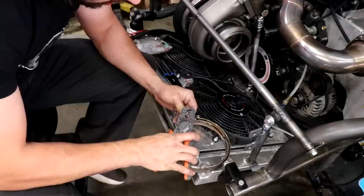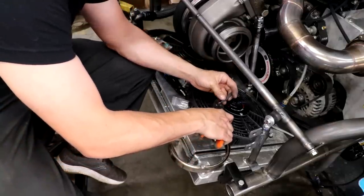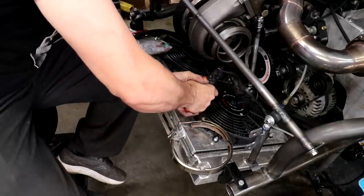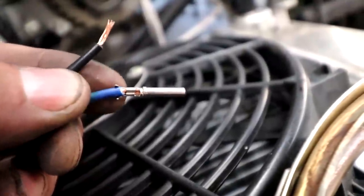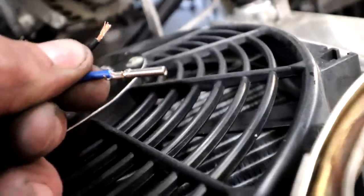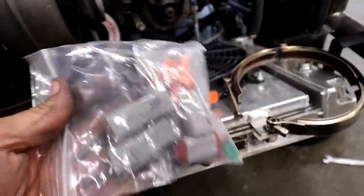I'd show you, but I'll probably mess one or two up. I like to get mine seated in the pliers first, and then shove the wire in there. Squeeze — hear all your muscles, your bones crack. It's a bit long, but it is crimped on the wire, and now we just have to crimp the little end piece and that's it. These are just as easy as using butt connectors, so get yourself some nice connectors, boys. I think they're like five bucks each on Amazon.